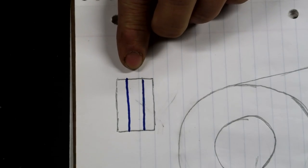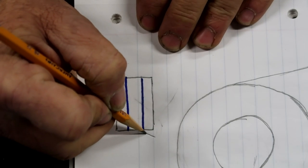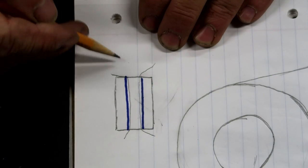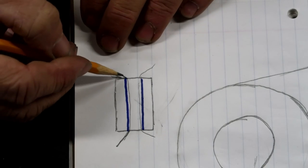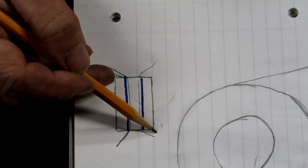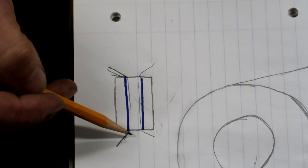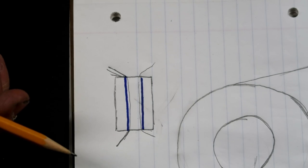You do not crisscross your chains inside a shotgun coil — you horseshoe them. The blue in the diagram represents the tunnel — the eye of the coil. Take your chains, come in through the eye, and horseshoe them out to the rails on both sides. If you pull chains straight against the coil face, vibration will damage the coil, so angle them away. Also build a barricade in front of the coil: stack four-by-fours on top of each other, run a chain over the top and tie it down tight to prevent it from sliding forward.